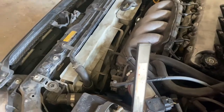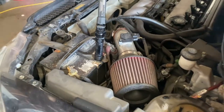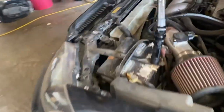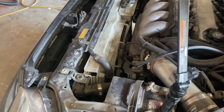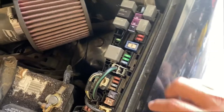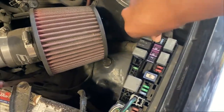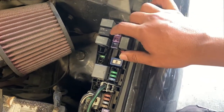So I'm going to check voltage on that, seeing if I have voltage. I'm going to let it sit for a little bit and see if they actually turn on right now, but it seems like they're not. So I'm going to take it off and check some voltage. I've already checked the relays — these two relays are for your fans, fan one and fan two. And then this one right here is for your fuse. Still good.